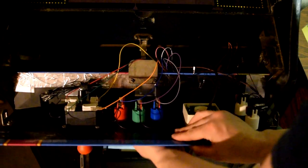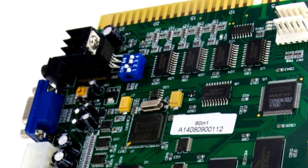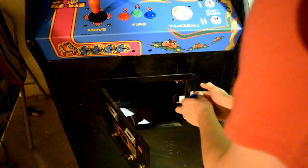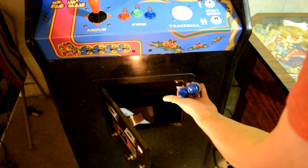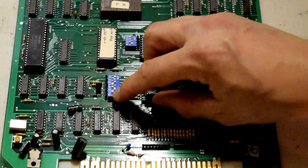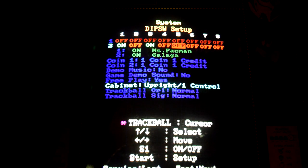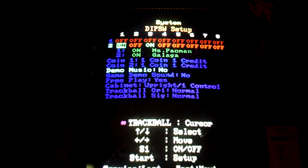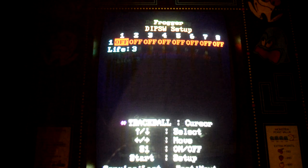There is some software configuration you can do. There are two ways to get to the menu: the documentation tells you to turn DIP Switch 4 on and then power on the cabinet, which is fine until you close up the back and push it against a wall. The second way, which is undocumented, is to hook up a button to the test lead of your JAMA harness and push it as you turn on the cabinet. If you don't configure settings, you'll end up with games starting with 1, 2, or 5 lives and extra lives awarded unexpectedly — because every game is controlled with virtual DIP switches, just like original arcade boards.